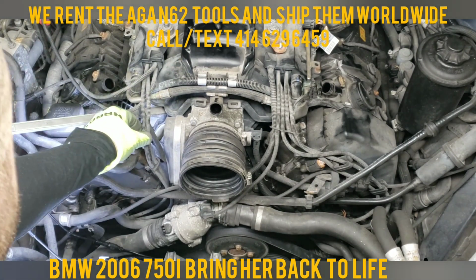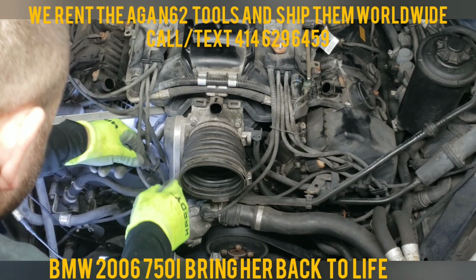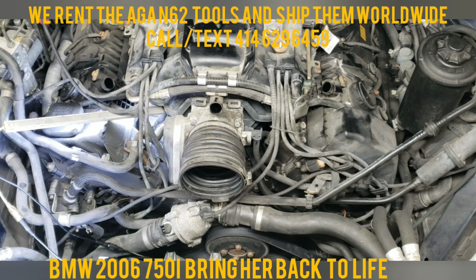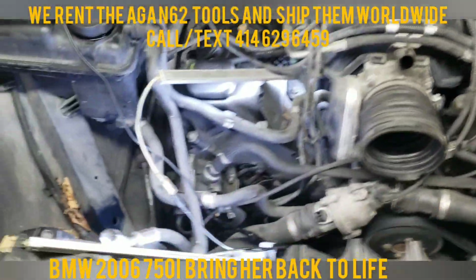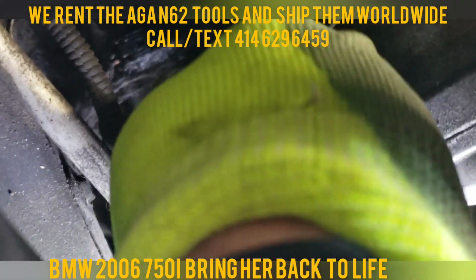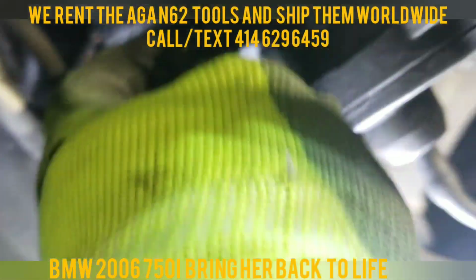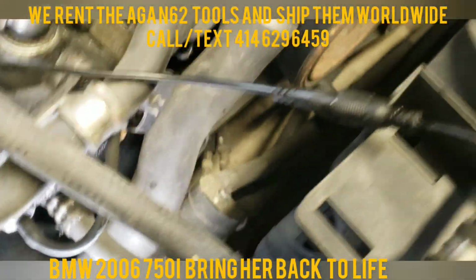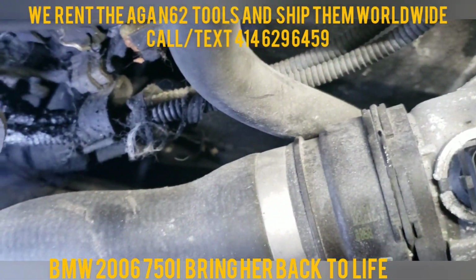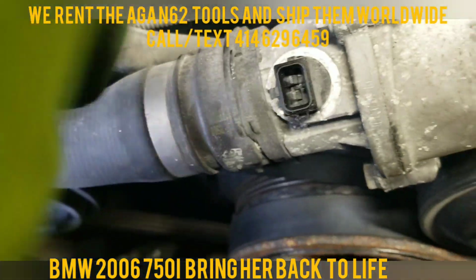The second one to your left, that goes all the way down here. Let me bring it down here so you guys can see better. The second wire right here, that goes to your oil sensor, which from this side is a lot easier accessible. And it's same concept. It's right here. This wire right here, on the bottom it's got the metal clip. You just clip it and you pull it right out. Here she is. So once you have that pulled out, it should have another clip connected right there. So you just want to pull it out of that clip so you free the hose.